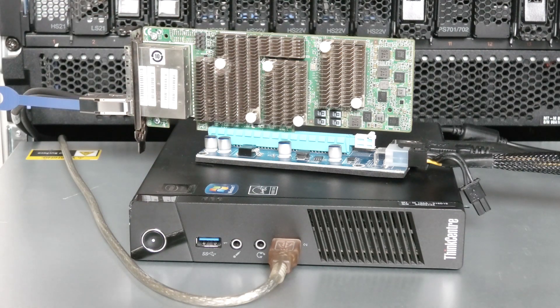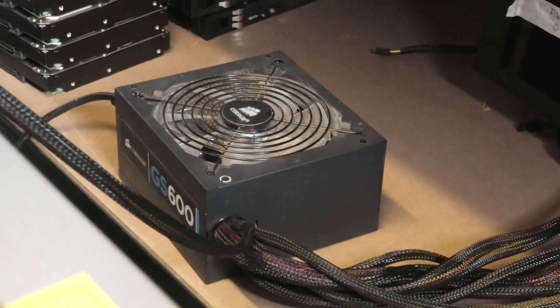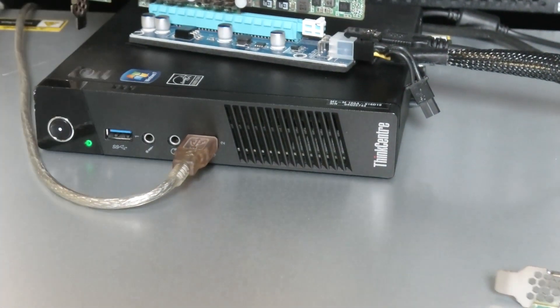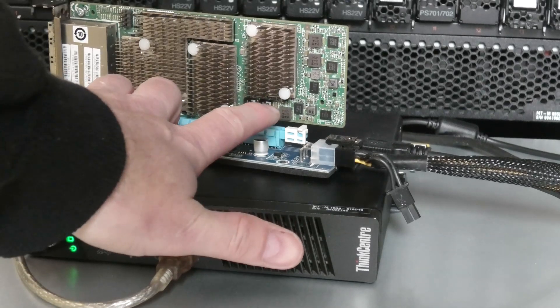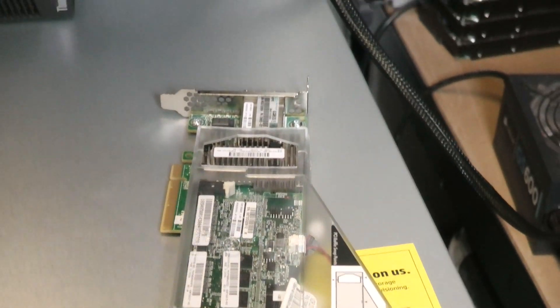I have no idea if this works at all. I hope so - I purchased it but I haven't tested it before now. The PCI card needs external power, and that comes in here - it's a six pin connector and it goes down to this power supply down here. I turn off the power supply when I turn off the PC. Turn that on, and on to the PC and turn that on. And while the PCI card lights up - I do see a green LED on the card. Windows is booting - that was quick. With the other card it took forever to check out all the drives. It didn't do that - that's not great.